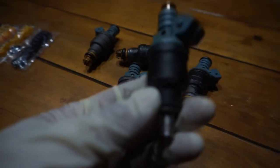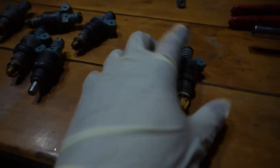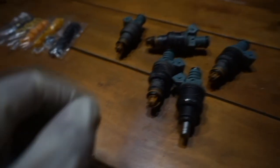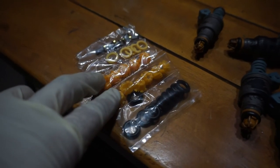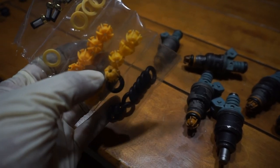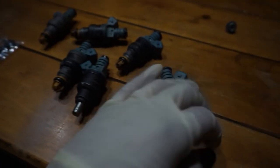I still need to do the rest of these. I'll show you guys how to rebuild the injectors — it's pretty simple. There are two o-rings, a plastic spacer on the bottom, a cap, and a filter at the end. The cap is pretty difficult to take off but I'll show you how. The rebuild kit comes with two types of caps — if yours has a small hole use that one, if it has the larger hole use that one.